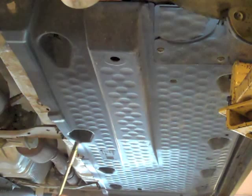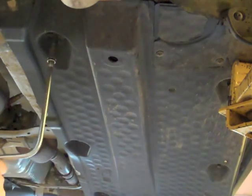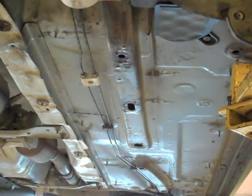I'm going to go nuts in here undercoating. I'm going to spray all in underneath there after I clean it all out first. It's far better done than I had thought it would be up and under here. In places like this unibody frame rail, they had sprayed in under there really well, right from the factory. I'm quite pleased with that. I'm going to continue in there as well. Over here on the rocker panel, that's all rock guarded and it's really sealed up very well. I'm quite pleased by that.